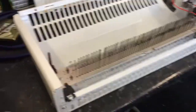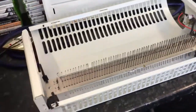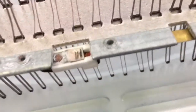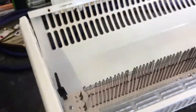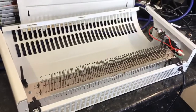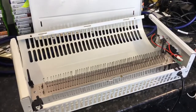It's very good for the manufacturers because the heaters don't work at all then, so people throw them away since these are only a 20-quid item to buy — it's a good sales device. But on this one, as I say, it's got an automatic reset on that thermal cutout, which is better than the thermal fuse. That's all from me; I hope it was some use to you on this convector heater. Bye for now.